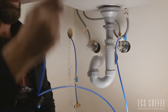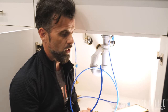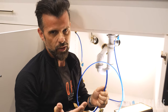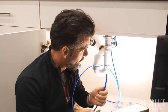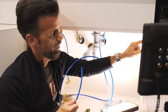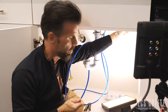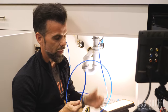Now you've got this line and it's going to go to the back of the coffee machine. In order to do that you're going to have to drill a hole through your countertop. If you have a stone countertop it's a little more difficult, but for a regular countertop you just need a quarter-inch drill bit and drill wherever you want the machine. For stone, get someone to do it with a stone bit. You may also have to go through side cabinets to get to where you want your coffee machine. My recommendation: try to do it near the top so you can go over appliances like fridges or dishwashers, run along the back, and then up into the area where you want your machine.